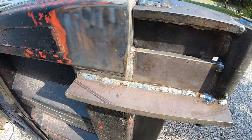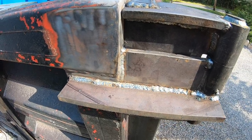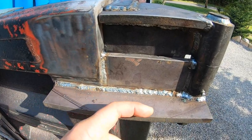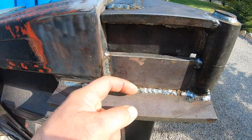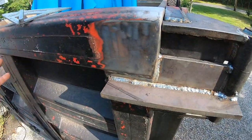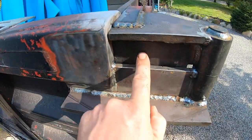And they're just a couple of stiffeners. I don't know if I'm going to box it in. I'm probably not going to. I don't think it's necessary. I might just trim this down a little bit. I did 2 inches because I wasn't sure. This whole tailgate has to swing on this, so you really need to have it kind of stiff. But this stays where it is.